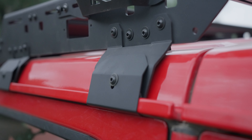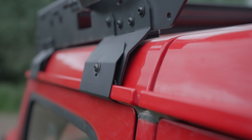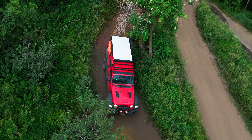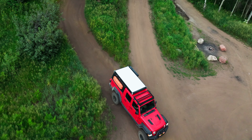It is always wise not to overload a roof rack, but I am very impressed that Trail Racks shares a static load rating of 600 pounds and a dynamic load rating of 300 pounds on the Gladiator roof rack. Those ratings are possible because this isn't just a gutter mount roof rack — it features load distribution feet on top of the roof to help carry the load before stressing the tiny gutters. I don't think the numbers are the same for the half rack; those aren't specified on their website, so I'd chop those ratings in half as a rough estimate. If you opt for the full rack, it is modular, so you can remove the Freedom Panels and still run the rear portion without needing to remove the entire roof rack.